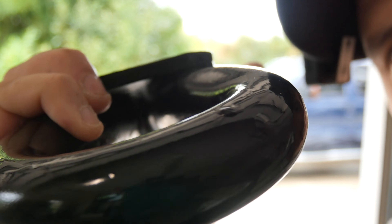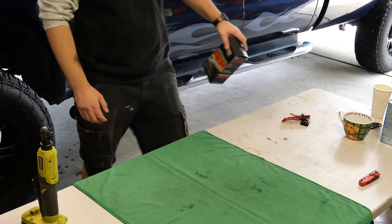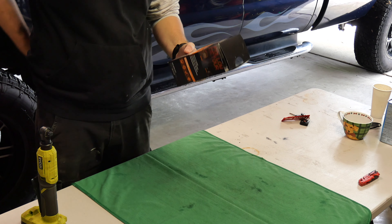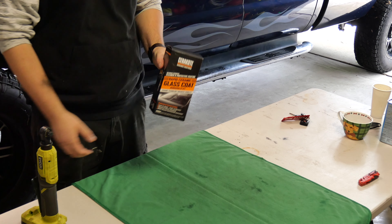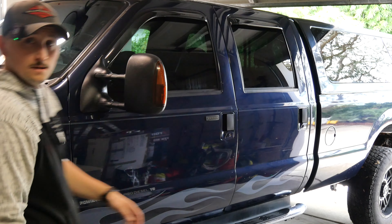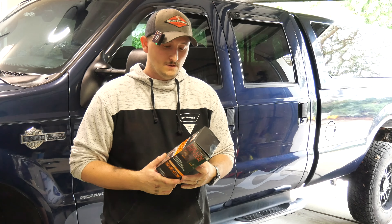Let's go ahead and put these on the truck — I have one more thing I want to do within this episode. So let's go install these bad boys. These are a 15mm bolt and they're kind of cramped up in there. So if you do have an angle ratchet, I would recommend using it — but you don't have to. I got them out without it. I do recommend using one of these guys — it's going to make your life a whole lot easier.